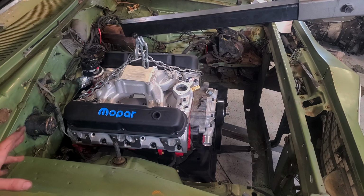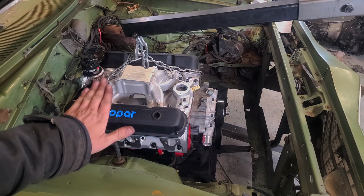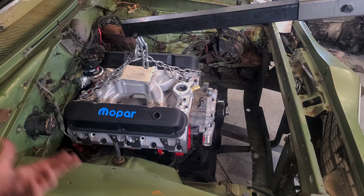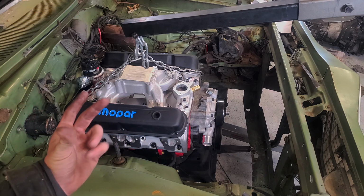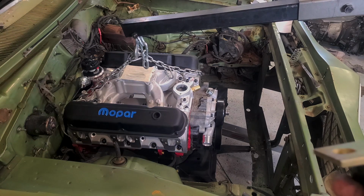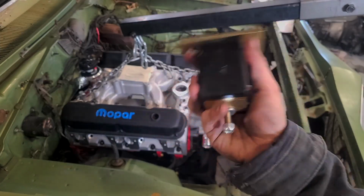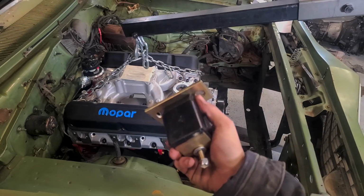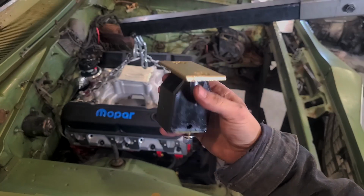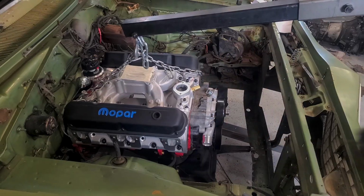Now there is some adjustment we need to do, but before we get the engine square this way, we need to get the transmission up and in. So down under, it's super simple. I'm just going to bolt our new transmission mount up and then put our cross member back on. Here's our new transmission mount. It's a polyurethane bushing. I was surprised how dang expensive these things are, but looks like a good enough piece. So go bolt this up and then get the cross member on.